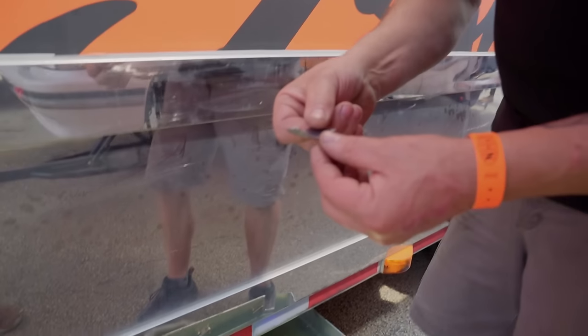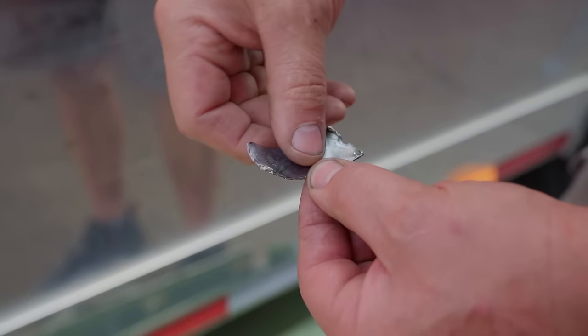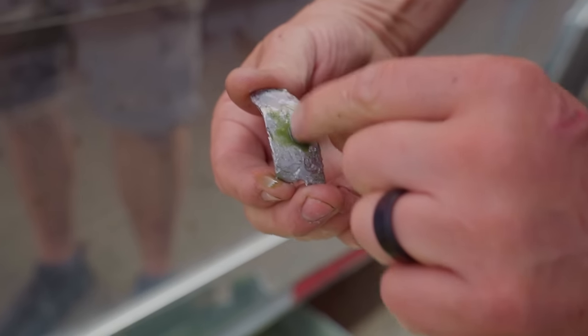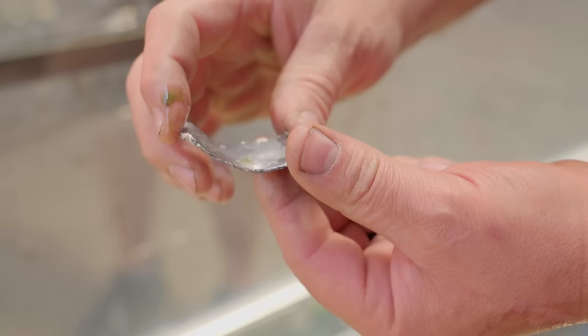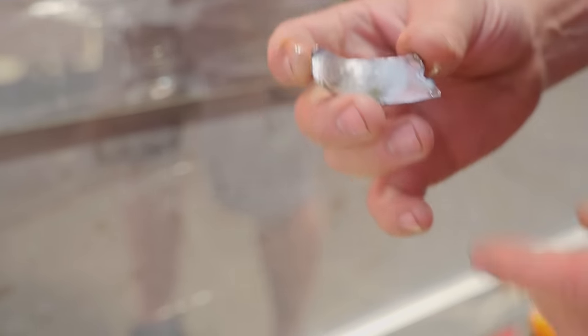Now, this is the bearing that was out of there. You can see this is the journal side. This is the back of the bearing that would be on the connecting rod side. That's nice. I mean, it had 135 pounds oil pressure, just like normal, perfect. Right after the burnout, all of a sudden, on the data log, it dropped 15 pounds, and that's fine, it went boom, dropped down 15 pounds, which means it probably broke right there.